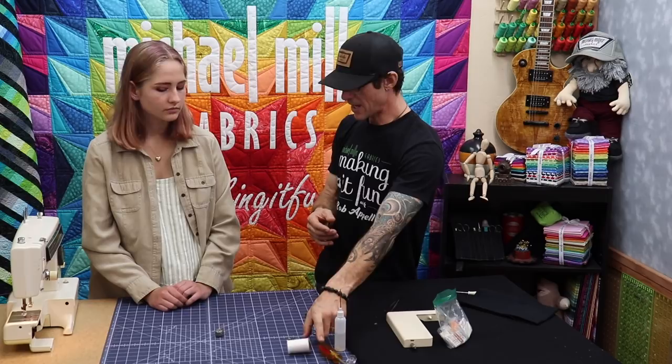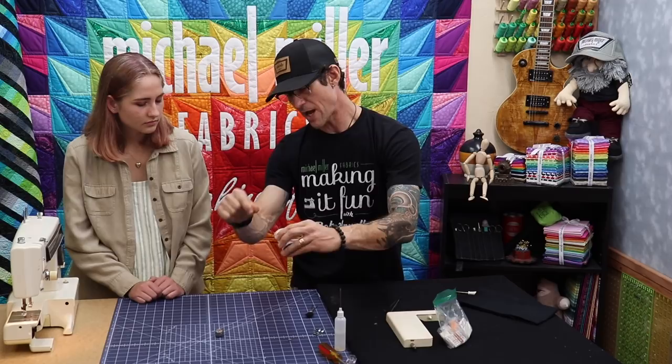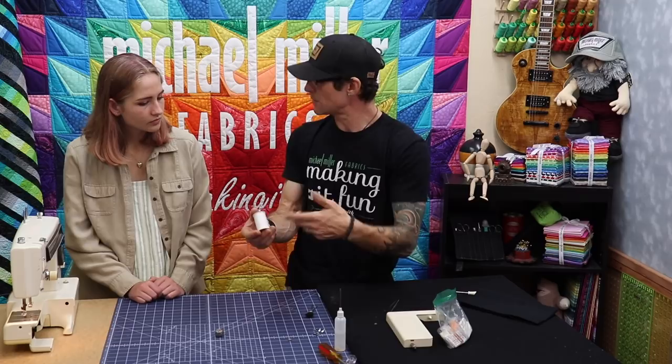Okay. And I will say this. Coats and Clark threads are very popular threads. They're not my favorite threads. A lot of sewing machines today use their threads sideways. And on these Coats and Clark spools, there's this wicked catch that as your thread comes around, it'll actually catch right there in the spool, and you can't do anything. It'll lock up. That is why it became my least favorite thread. There's a big groove on both sides, and unless you use the proper spool caps or nets on your threads, a lot of times that will cause these erratic stitches.